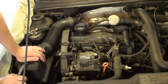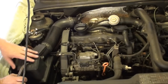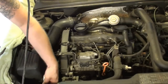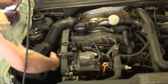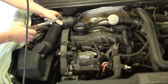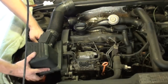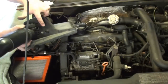As you can see that opened up the whole top for us. Next we're going to try to open up this area, so I'm going to remove the air cleaner box. I'm going to unplug the mass air flow sensor — got a couple clips, just pop them. Pull that back — you've got a vacuum line right on this lower side, so you can unplug that. It's right here, and that went right to that vacuum port.